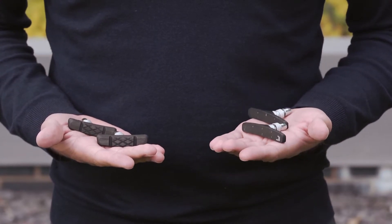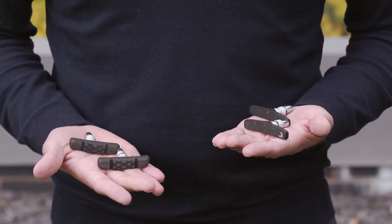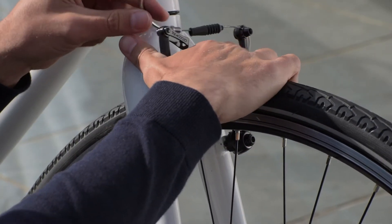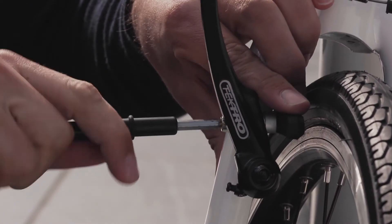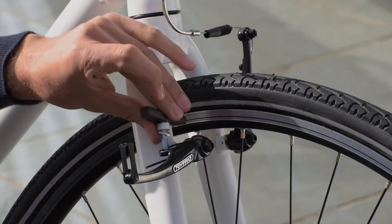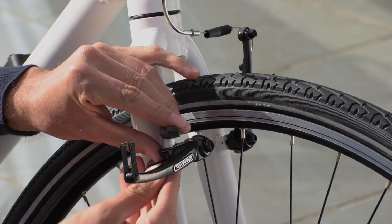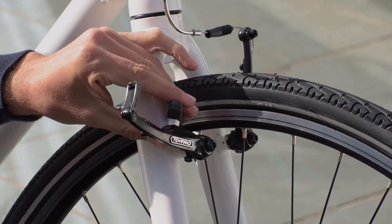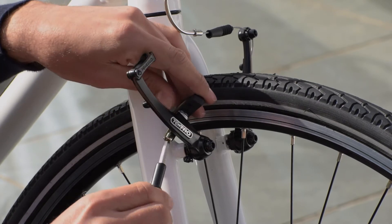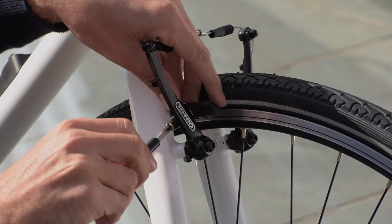Eventually, after many miles of riding, your brake pads will need to be replaced. When the grooves on the pad are worn down, it's time to fit new ones immediately. Disconnect the brake and loosen the brake pad fixing bolts to remove the old brake pad. Make sure to keep hold of the screws and washers. Then simply pop in the new pad and screw it securely into place. Once it's in place, make sure it's aligned with the wheel rim as shown before, then hold it securely in position while you retighten the brake pad fixing bolts.